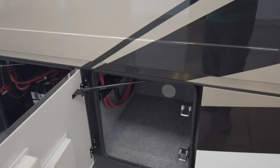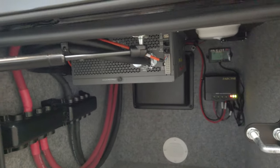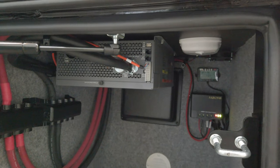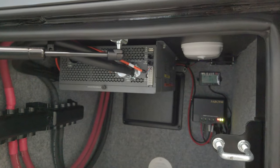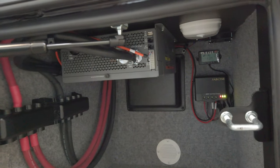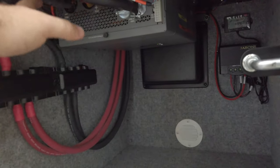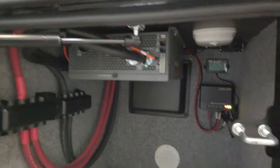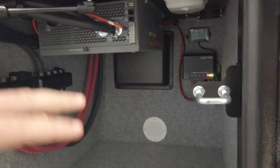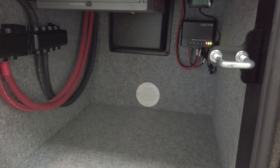This coach has not been hooked up to power, so the batteries have come down just a little bit — not drained, but enough that this 3,000-watt pure sine wave hybrid inverter is in charge mode and bulk charging those batteries. What's important to note: you can store some stuff in this bay, but don't stack blankets and towels against the inverter where it can't breathe because it puts off heat. There's a vent in the back to let air circulate — put something in here like a hard plastic bin or toolbox that still lets air circulate for that inverter.